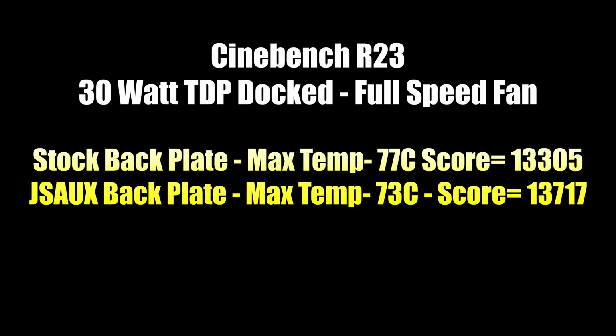So the next thing I did was take it up to 30 watts in dock mode with the fan at full speed, so we can adjust that curve in manual mode. With the stock backplate, 77 degrees Celsius, our score was 13,305. And with the new backplate, our maximum temperature was 73 degrees Celsius. We had a score of 13,717. So yeah, I mean, we are getting more airflow in here.